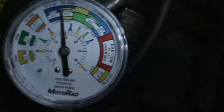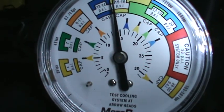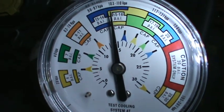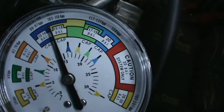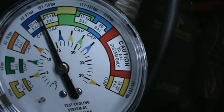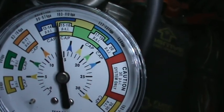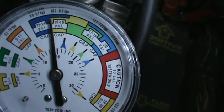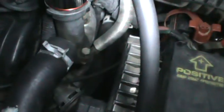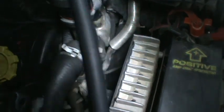It's slowly going down. 4 PSI cap, 7 PSI cap, 9 to 17, 13 to 14, 15 to 16 — caution: 30 PSI system only. Looks like we got a small loss. It loses from 15 to 16, goes to 14, then it stays there. I think honestly all we got to do is a thermostat — it's a good idea.